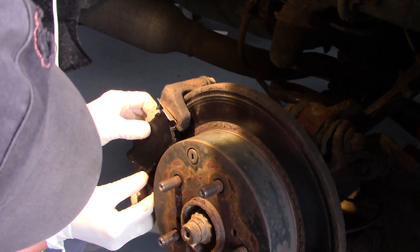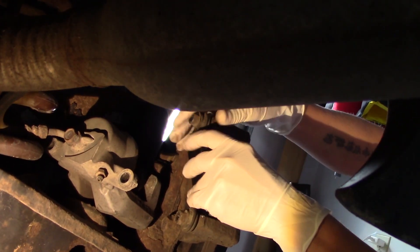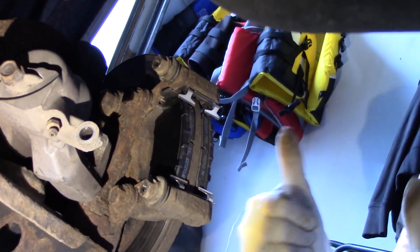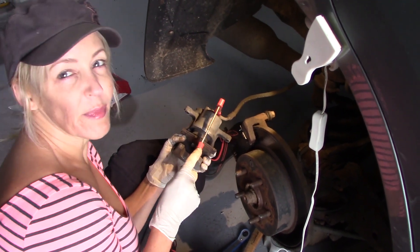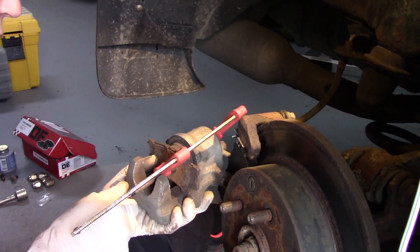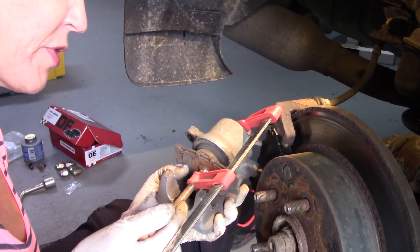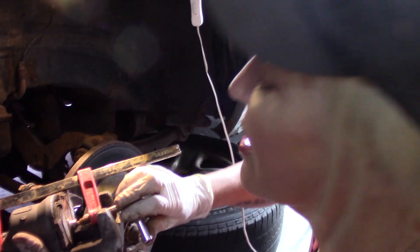Get these clips out of the way to snap it in place. One in the back — this might be a little tricky because it's hard to tell — and bam, back one in first. The caliper here seems a little tough, doesn't seem like it wants to move. What I've got is the old brake pad flush against the caliper and a clamp, and I'm going to slowly wind the clamp in to get that to move. Slow and easy does it — apply some pressure.